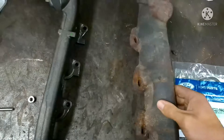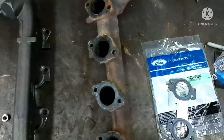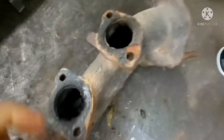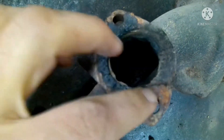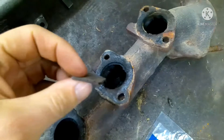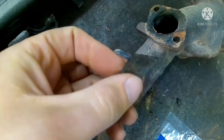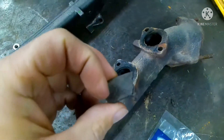The only thing I do notice, and don't like about using aftermarket parts, is the gasket material they use. You can see on this one, this is where it failed. You can see where the gasket material broke off and blew out. They use a metallic gasket material. It's soft and pliable. In my experience, it doesn't last very long.